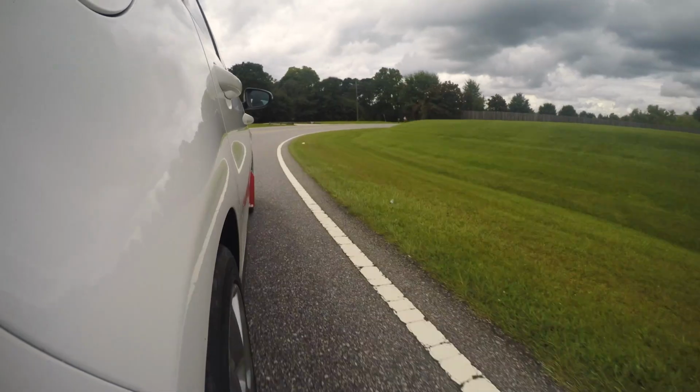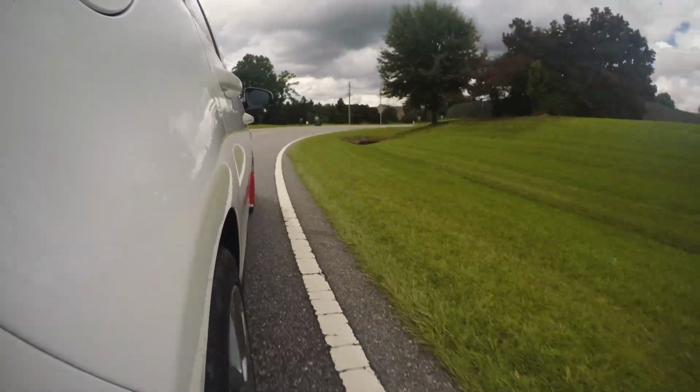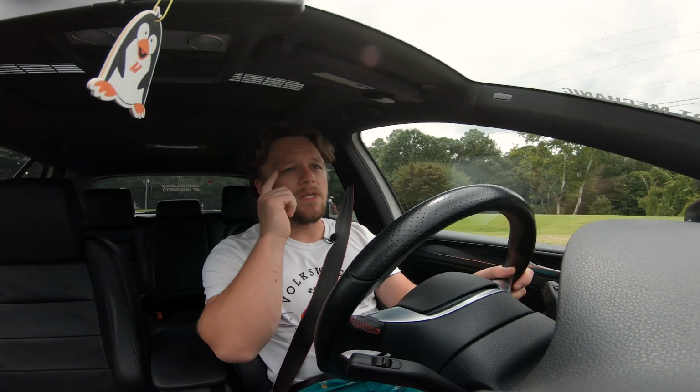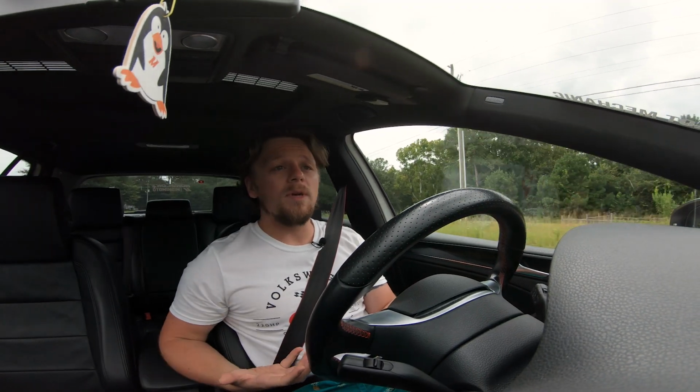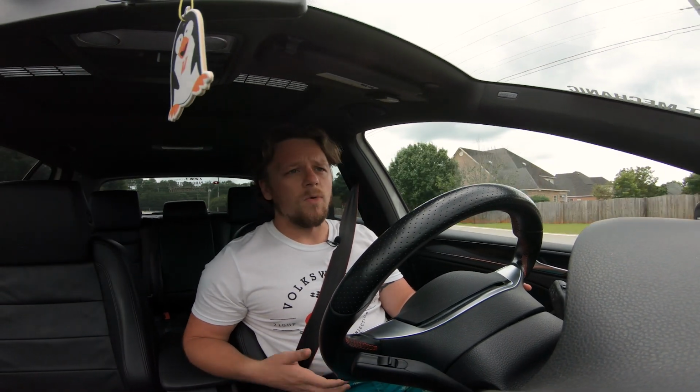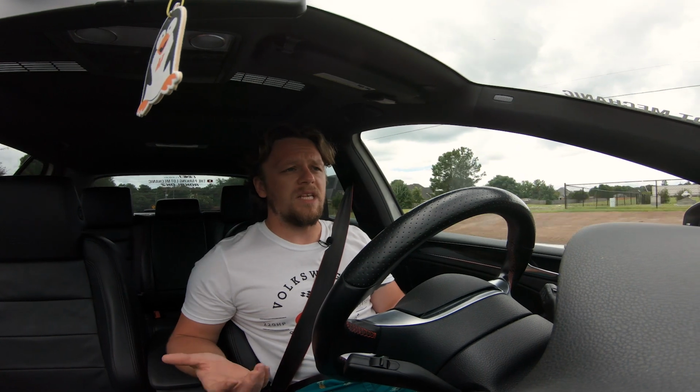Personally, I didn't want to go too extreme on the rear sway bar upgrade. So to start, I went with the 23 millimeter ECS Tuning solid adjustable rear sway bar. I'm not too worried about the thickness of the sway bar because this bar is solid, so it's going to be that much better than the 21 millimeter stock sway bar. Now it's 21.4 millimeters, something like that, or 23.4 for the ECS. Anyways, we're just rounding down for simplicity.